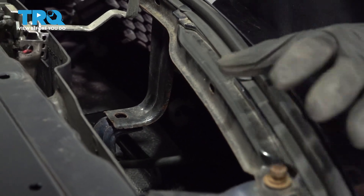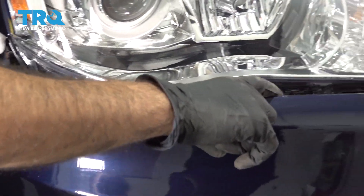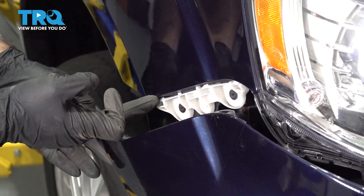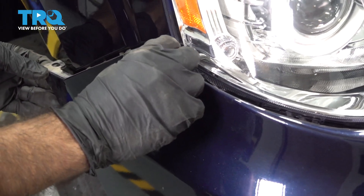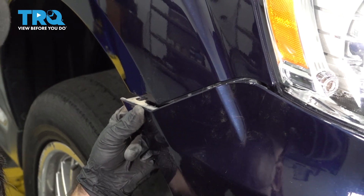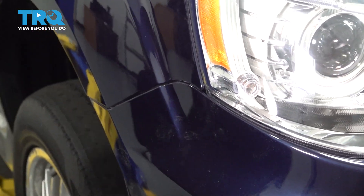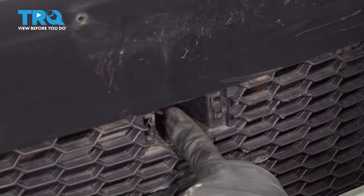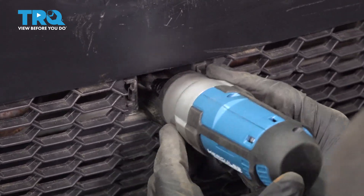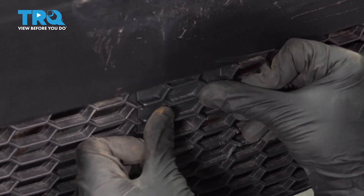Move to the side and clip it into the fenders. Pull the bumper out a little — there's a piece that has to slide into the groove on the bottom of the headlights, and this piece here has to slide in here. You will hear a click; you may have to push in with some force to get the pieces to seat. Put one more 10mm bolt in on the bottom and snap your cover in place.